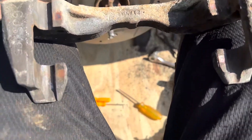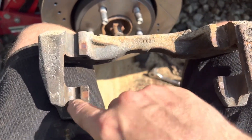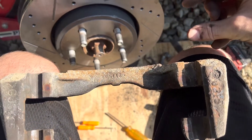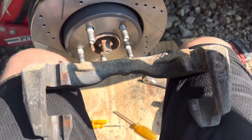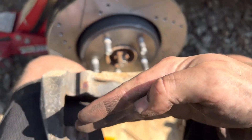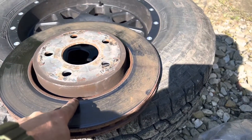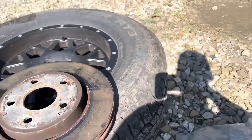Which stems from here. When your brakes slide in and out, or your caliper bolts are not able to slide in and out — they're supposed to have grease on them — it does not apply even pressure. Your brakes get stuck in between motion and can lock like this, applying uneven brake pressure, resulting in a warped rotor. This part is raised much higher than this part, so it's applying uneven pressure to the bottom side of your rotor.